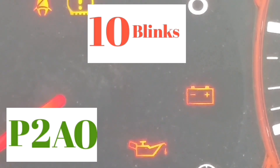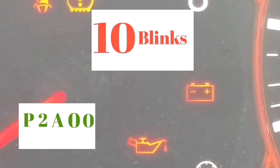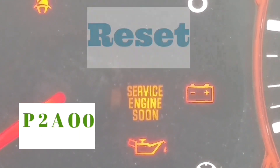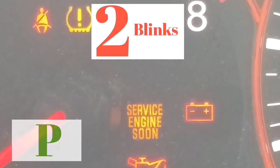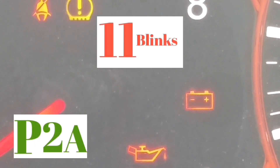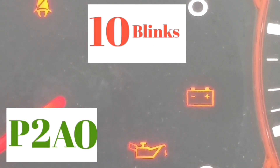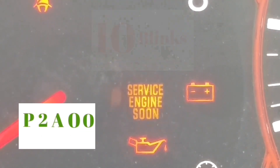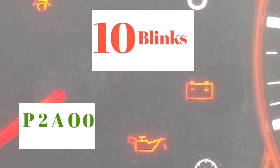It's going to take a little bit of time to figure out how to read it — you might have to do it a couple of times. But if it doesn't work out for you, you can get an OBD2 reader — they sell it for around 19 bucks at Walmart, eBay, or Amazon. Or you can drive to AutoZone, Advanced Auto, or any other parts store that does simple service engine soon light diagnostics.